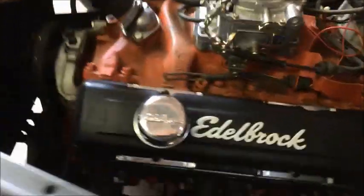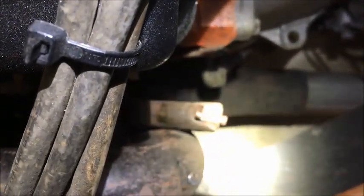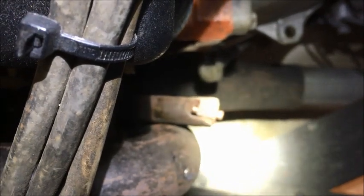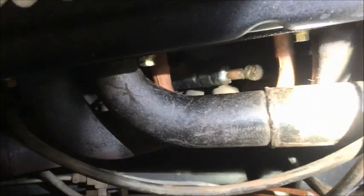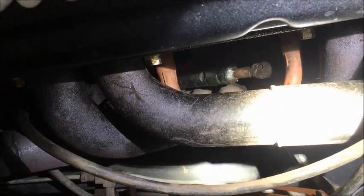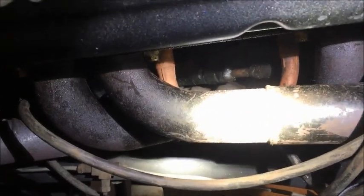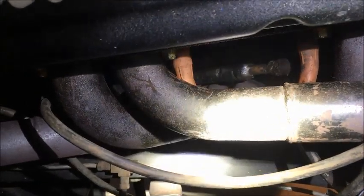But the column's out, and as soon as I pulled that column out of there, this steering shaft sprung over and is now hard against the header. It just amazes me every time I do something on this car and see this stuff. I'm not sure if you'll be able to see, but that's where a 3/8 extension was welded in there. And the part on the left goes down and is actually the steering box, no splines again. So I'll have to cut it down there someplace, and then put a U-joint there, and then come out toward the firewall.